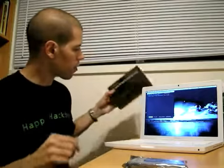It'll take a long time. I prefer to just clone the drive directly. To do that, we're going to make use of an external USB 2.0 enclosure. We're going to put the new drive inside the enclosure, clone the disk from the internal disk of the laptop to the brand new disk. When we're completed with that, we'll remove the disk from the enclosure, install it into the laptop, remove the one that's inside, and hopefully we'll be able to start up and continue just like nothing happened. We'll just have more space.